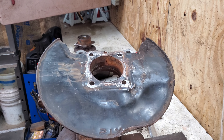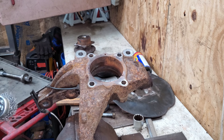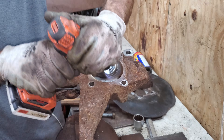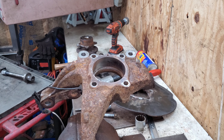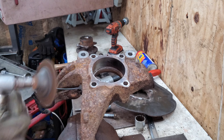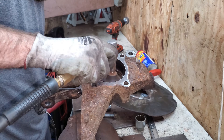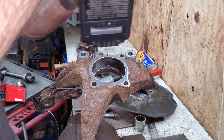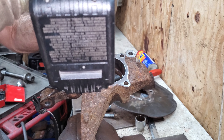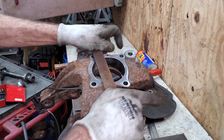Nothing a little spanking can't fix. I'm going to get in here with a little wire wheel action and do some de-rusting. That wire wheel was a little impractical - I'm going to get in here with a whizzer wheel. I need actual sandpaper, that's some thick rust in there. I kind of boogered up a hole a little bit - it's almost a 31/64. Give it a little draw file action.